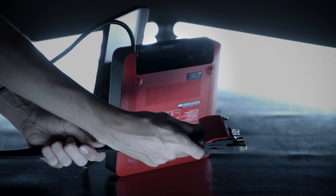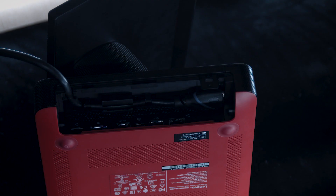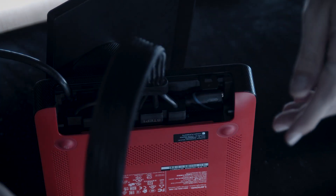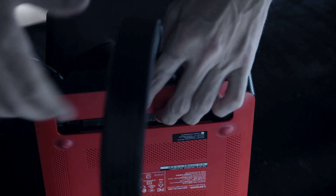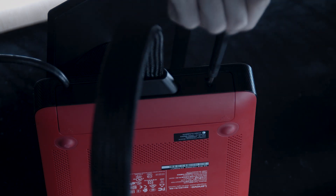Next, take the red side of the one cable and slide the cover down to reveal the blocks of connectors. Align the cables labeled Step 1 and Step 2 to the ports on the base. Gently push the connectors in, moving from right to left. Slide the red cover along the one cable, align the HDMI ingest cable to the notch, and snap the cover into place. Install a security screw into the one cable cover.